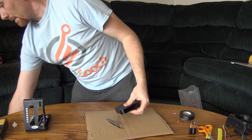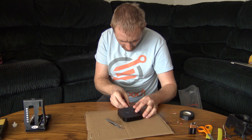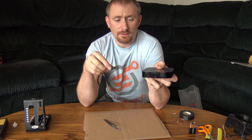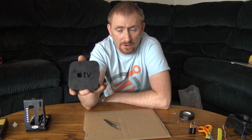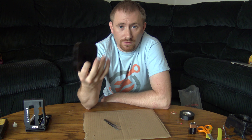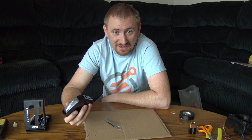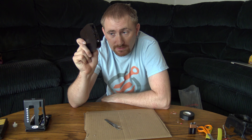I'm going to plug the power cord back in one more time — as long as it lights back up, I'll be happy. And it lights up. So that is how you convert your Apple TV to run directly off DC power. I converted mine to run off 5-volt DC via USB connection, but you can convert it from 12 volt or whatever voltage you want using the appropriate step-down module.